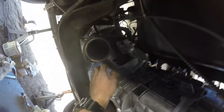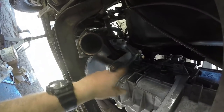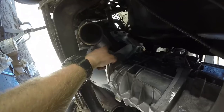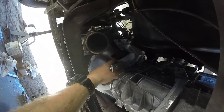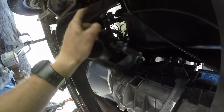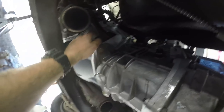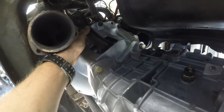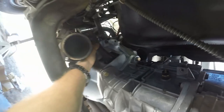Drive shaft is slid in. I had a little mishap again with the clutch fork — I was stupid and forgot to put the clutch fork on the throwout bearing before I put the whole thing together. There was no way I could get both the clip onto the bell housing and the fork onto the throwout bearing at the same time. So I had to take it all apart, slide the trans back out, put the throwout bearing on the fork, and then slide it all together in one big piece. Now we have no up and down movement and a perfect back and forth movement — that's exactly what we want.